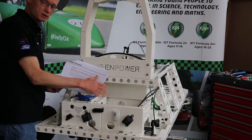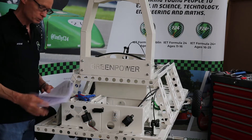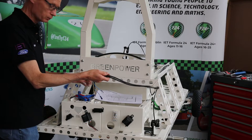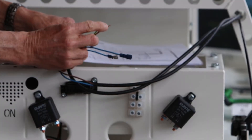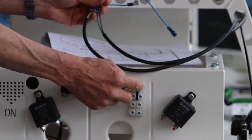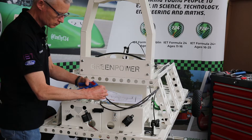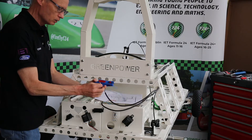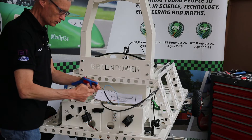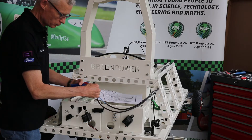If you've got it all connected right, when we get to putting the batteries in, it'll all just work. The second point is that when we come to actually connecting some of the cables - I've got examples on the two that we installed at the front earlier - these bare bits where the insulation has been taken off may be a little bit short, because these are going to go into the connector block. So I'm going to use my wire stripper. I like about 10 millimeters of bare copper wire. When you've stripped a bit of wire, it's best to twist it a few times - it helps keep it tidy and neat, otherwise you end up with the wire fraying and it becomes a bit of a mess.